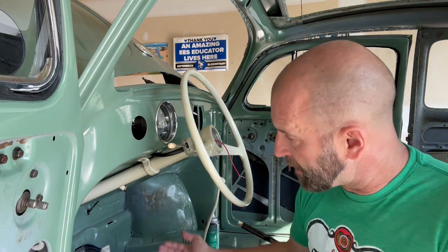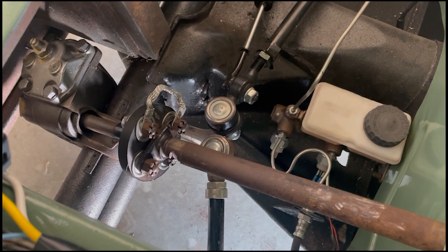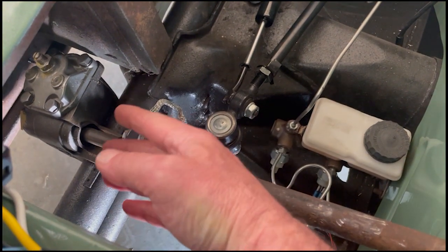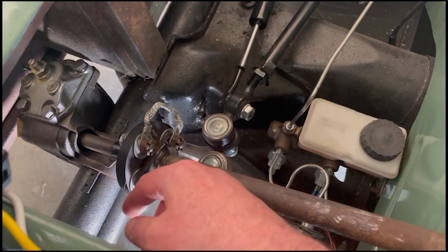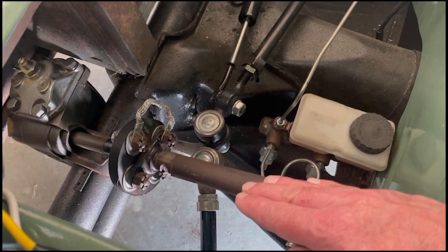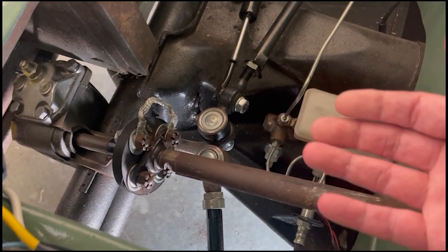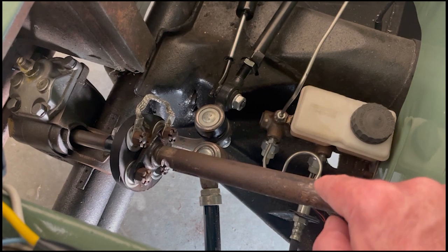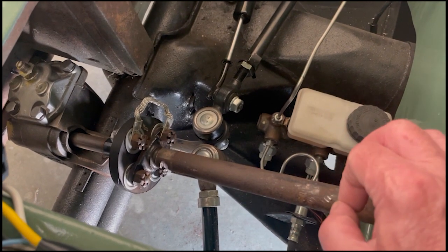Here's my button — this needs to be shiny on both sides. So once you have all that down and you have the commutator properly aligned with the brush and the steering box, you're in really good shape. You're not going to have a problem with the power — that's a hot wire direct from the battery. It's going to be a grounding issue for you. A couple of points here with the steering shaft going into the box: the difficulty I had was I replaced the steering box. This is a TRW, it's Brazilian, it's a reproduction. When I replaced it, this shaft was a bit longer and that pushed the steering shaft about an inch further in. That threw off the commutator — the brush that is on the steering column.